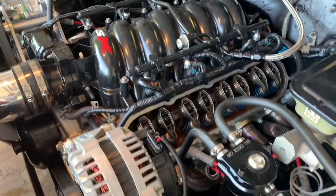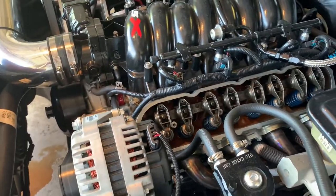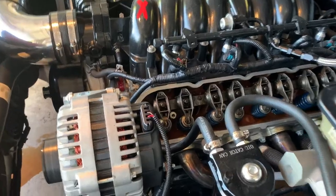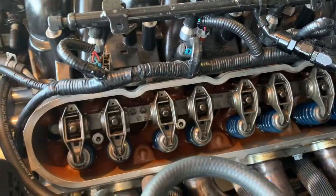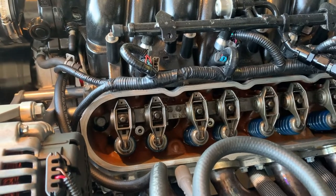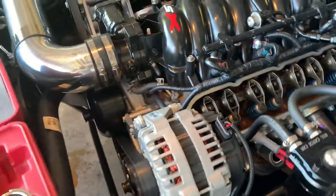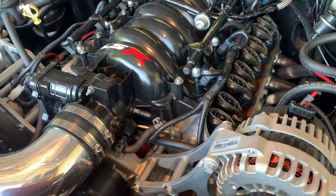Pump it up and look at both sides — most times you remove the rockers to see it. On the 5.3s, the 706 and even the 862 heads, and specifically the Castech-brand heads, they are known and prone to cracking right here at the center bolts — not the outer bolts, but the center mounting bolts. They crack not because they were over-torqued, but because they have a weak spot in the casting. All of them eventually do it around 100,000 miles or sometimes less.